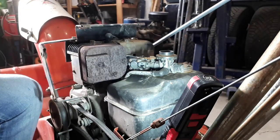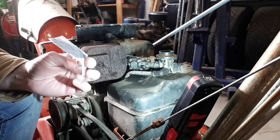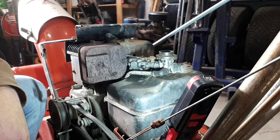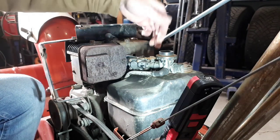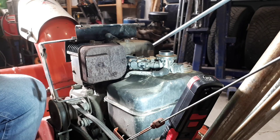I changed this diaphragm out — if you recall it wasn't really running full time before, it would stall out. I picked up a 10-pack of diaphragms from Amazon; they're not Briggs OEM but they're a lot cheaper. I was about to put it on and I noticed that my governor link was sitting kind of funny. It turns out that the screw on the other side that it pivots on had fallen out, so maybe that's why it was dying.